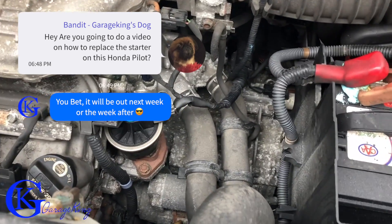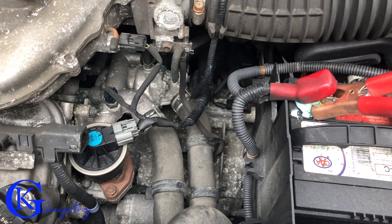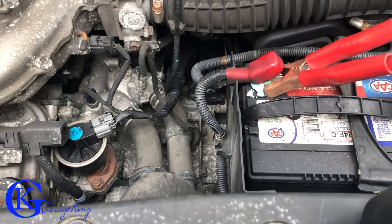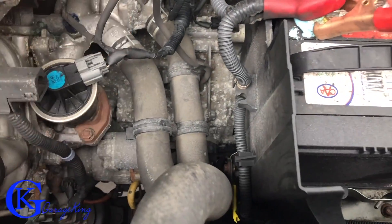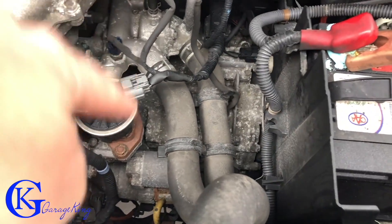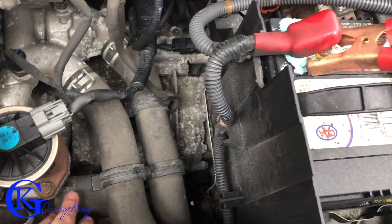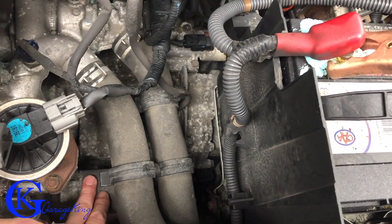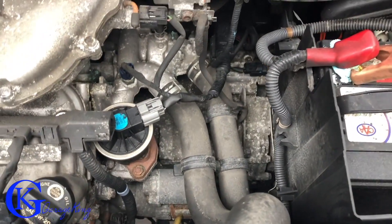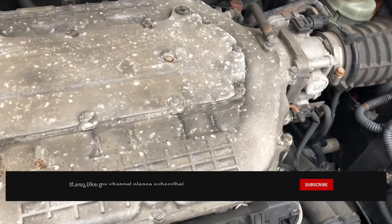All vehicles — you should hear that fuel pump run. Obviously if you have a carbureted car, a really old car, you're not gonna hear it run because the fuel pump is mechanical. But any vehicle built in the 90s or later, they're all pretty much fuel injected, so you should hear that fuel pump run. Then listen for that clicking — those are two very important things to listen for. If we didn't have clicking in the starter but we had our fuel pump, we would then be going in and checking our relays. But we don't need to do that because we know we're getting power to the starter because we've heard it click. Also, when I put my hand on the starter and have an assistant turn the key, I can feel the clicking, so I know the clicking is actually coming from the starter and not from anywhere else.